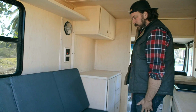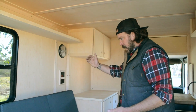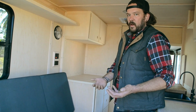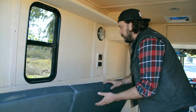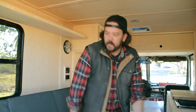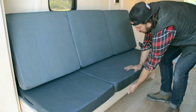So moving on to our conversion couch. This is a 3-seater couch that'll provide 2 sleepers. It goes into a full size. One of the cool things about this, it's a piano key sliding style. It's seen in a lot of online threads, a lot of DIY pictures, and the way we did it, I think, was one of the best ways I've seen it done so far. We have a drop leaf back here that sits on top of the bottom cushion, and that provides a nice 10-degree pitch for when you're sitting. You don't have a 90-degree pitch, so it feels like any couch. And it pulls out to a full-size bed.